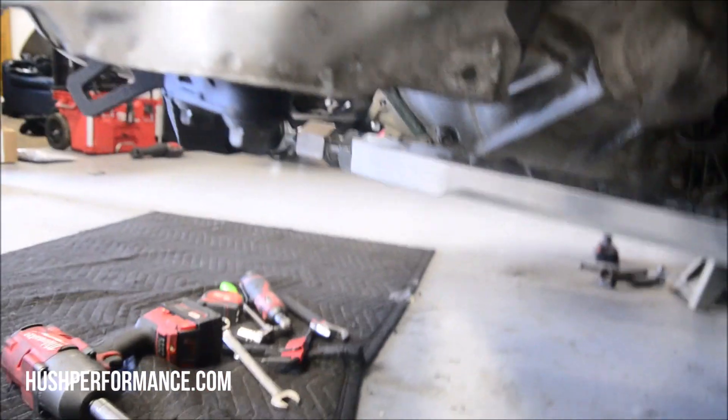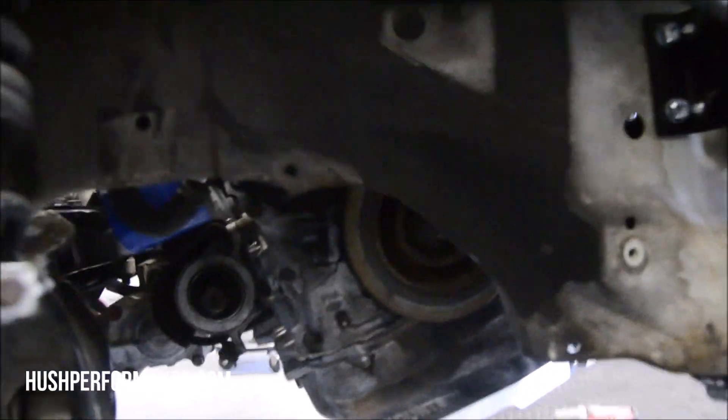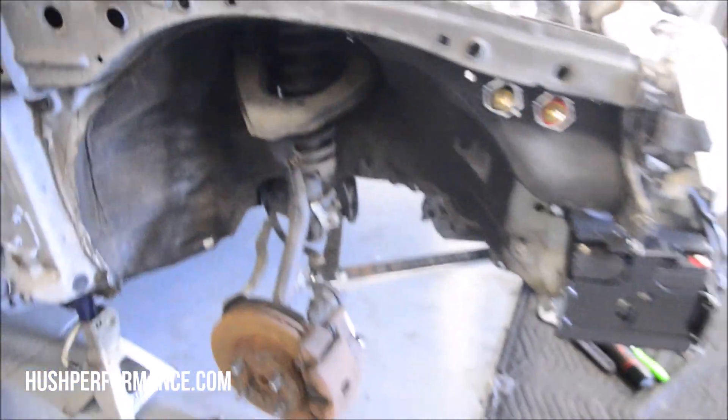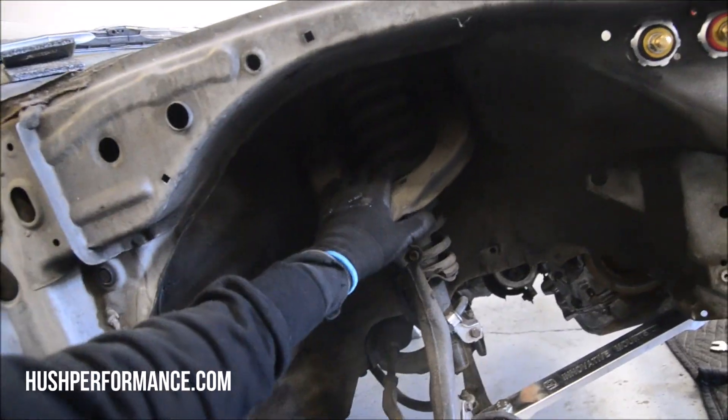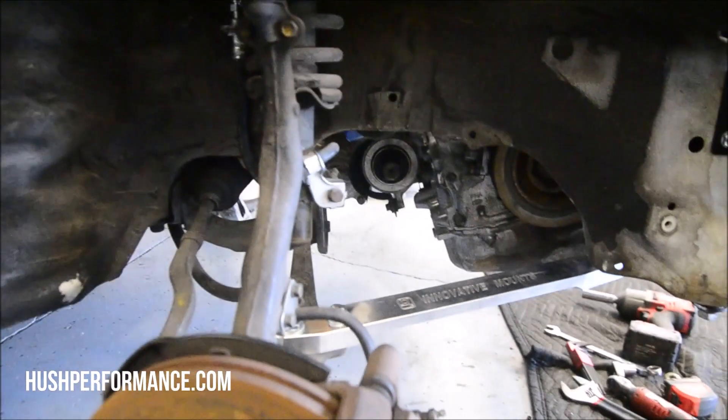I am not mad at you, Innovative — this is pretty much the nicest and easiest one I've installed. The adjustment is on point, I dig it. Now, something that's known with the K-series in the EF is this pulley right here. This pulley may rub on this part here, and that really depends on ride height. Some of you guys want to be really low and that could create a problem. This one we're going to send at stock height, but it's also going to be a drag car, so depending on how the suspension works out will determine what happens there.